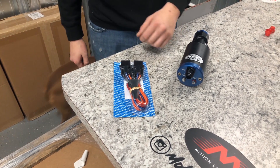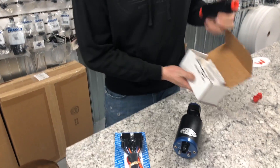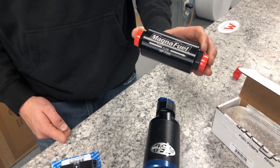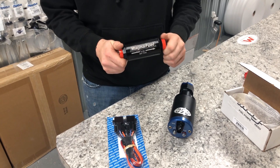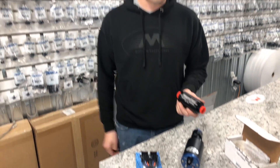If you need more information on the relay, there's a little instruction booklet inside of the kit — it'll tell you how to hook it up. The last thing to note: this pump is suggested to be used with a 74-micron pre-filter and a 24-micron post-filter — MP7008 and MP7009. These are stainless filters. The nice thing about that is if you run E85, you can take them apart, spray them out with brake clean, and they'll work just fine. Paper filters tend to gum up or go bad with ethanol fuels. I always run these filters. There are other stainless element filters from other companies, but make sure you run a stainless element filter. There's no reason not to — 74-micron pre-filter, 24-micron post-filter. These can be found on our website as well.